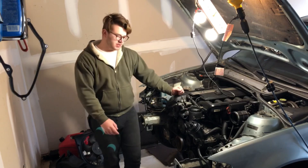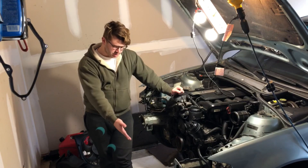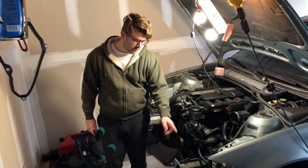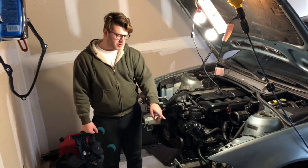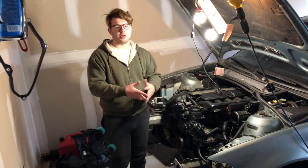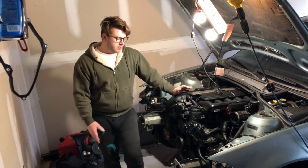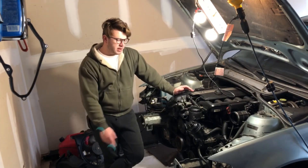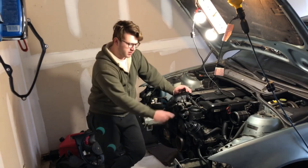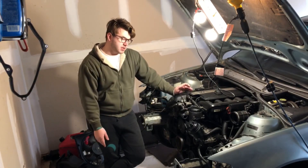But there was still some stuff in the way. And as you can see, in the past few weeks I've removed the radiator and the air conditioning radiator down here as well. I still have to remove the power steering pump, but it's being very persistent because the BMW connectors are known for being notoriously broken and the plastic in the connector broke, so there's no way for me to actually get the connector off without just cutting it. The power steering in this is already completely shot anyway.